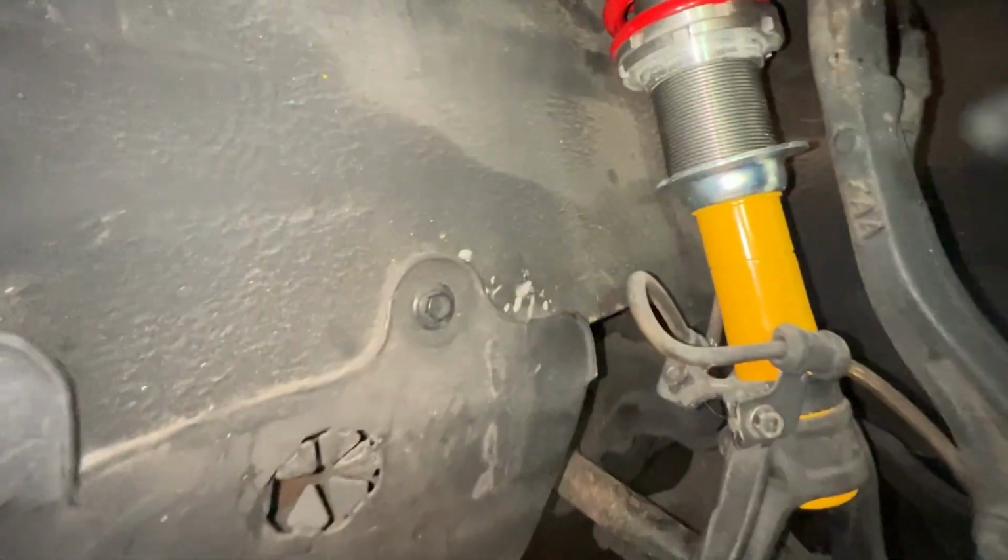We're gonna stay in the shop today and work on the 97 Type R. The suspension when it came in was a little bit off. It was a little bit high in the front, and the reason is we put on it not too long ago a set of Koni Yellows on the old Omni coilovers here.